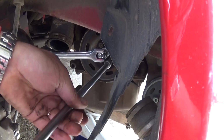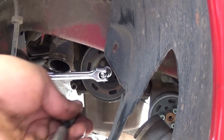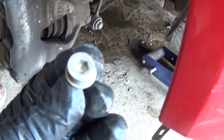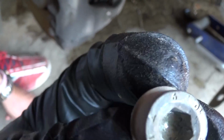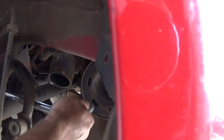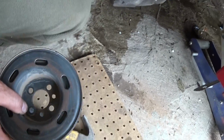And we just got them loose, so now we can just take them off with a little impact. Save you guys some time so you don't watch all that stuff, but you know what to do. Okay, just be very careful, use the right size Allen wrench, because if yours is worn out, you're going to make those round, and you won't be able to remove them, and that will be catastrophic. Okay, we removed all 4 of them now, so you can pull that socket out. Okay, just like that, and now you can pull the crankshaft pulley. As you can see, that's what it looks like, guys.